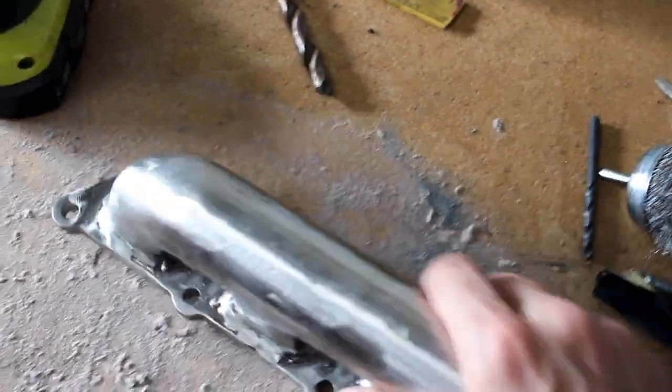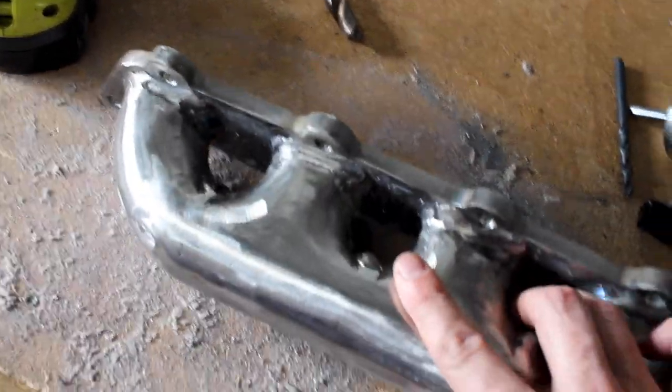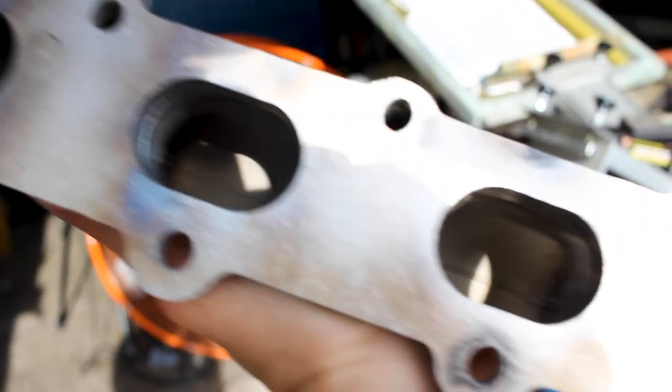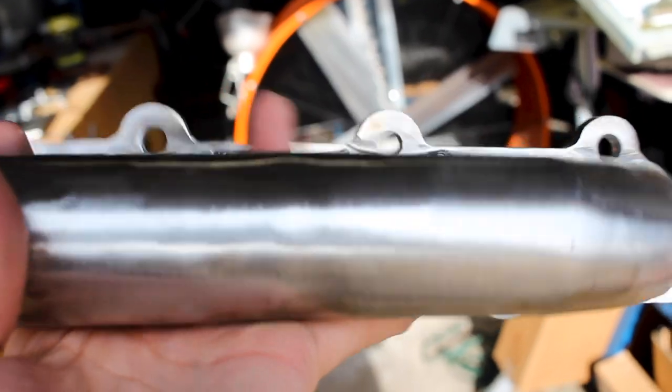Here's where I am so far. I took the flapper sanding disc wheel and smoothed out the welds so I can start piecing this together and figure out whether it's going to go on top or on the bottom. My welds came out okay — I started getting better at it the further along I went. There's a lot of splatter, but I'm not going to waste too much time on it. I've been smoothing out the flange to the piping, but I'm going to hold off on that until I get the T3 mount on there. I'm going to cut this piece up and fit it to the manifold and the T3 flange fitting.